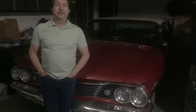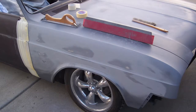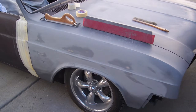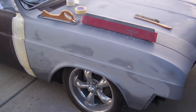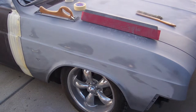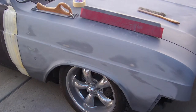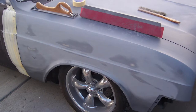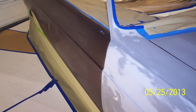Now that I've got everything aligned the way I want it, all my edges are clean, and all the touch-ups smoothed out. I ended up having to re-sand the passenger side front fender. When I bolted down the inner fender well, it popped in at the top of the fender well lip. I was worried I'd have to go back to filler, but it was kind of like the oil-can effect — it popped back out and stayed solid. I was able to smooth it out and sand the primer and filler just a little bit, ready for another coat of primer sealer surfacer.